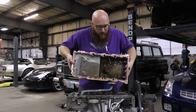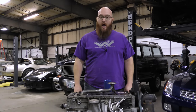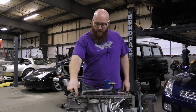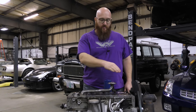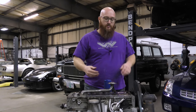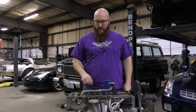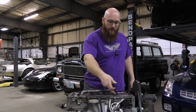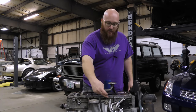Between the oil pan and the block is actually the oil manifold — it's a very thin plate with grooves that allow oil to flow through passages and go to different parts of the block. This is definitely a big leaker. You can have 30 to 40 PSI of oil running through these channels, and if there are any compromised seals or gaskets, it'll come out the sides.